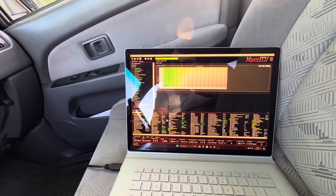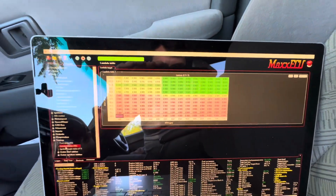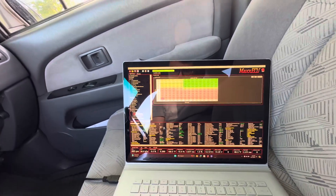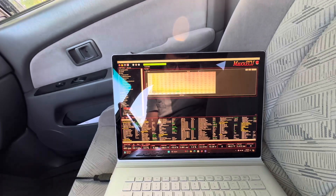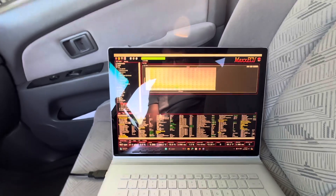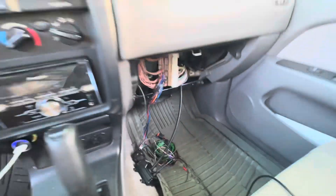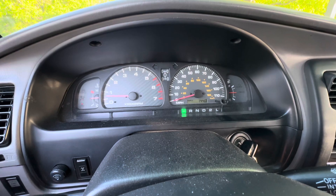Here's a rough lambda target table — I'm just feeding it some fuel up top at peak torque. I've got a generic base tune on this that I've done on the street. No dyno tuning yet. I do plan to take it to the dyno and see what just the tune does, but I can tell kind of seat of the pants — it's probably like a 10% increase.